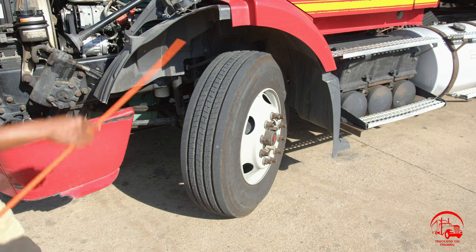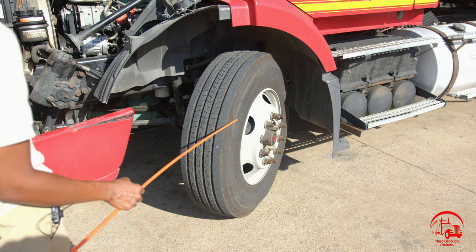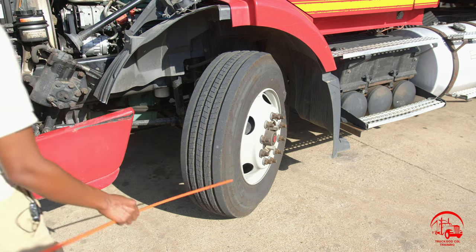I have my inside and my outside tire wall. It is properly mounted and secure, not bent, broken, or cracked. There are no abrasions, bubbles, cuts, or dry rots. It is properly seated to the rim, and it is not leaking.